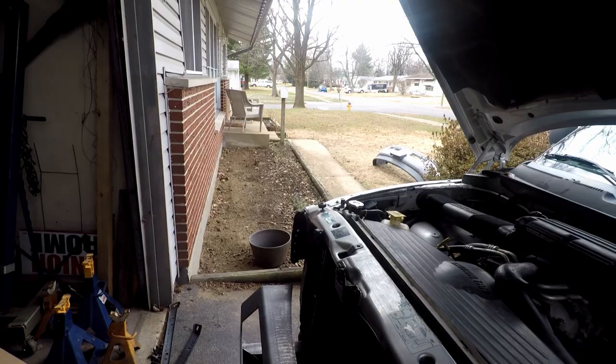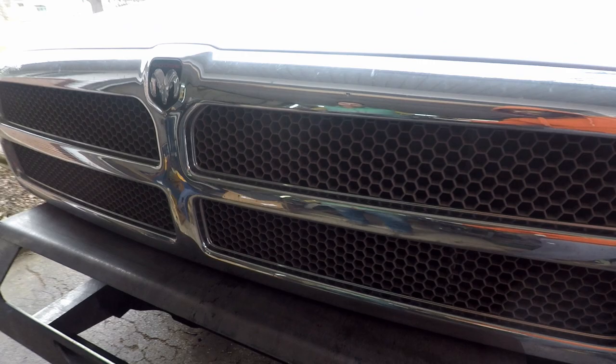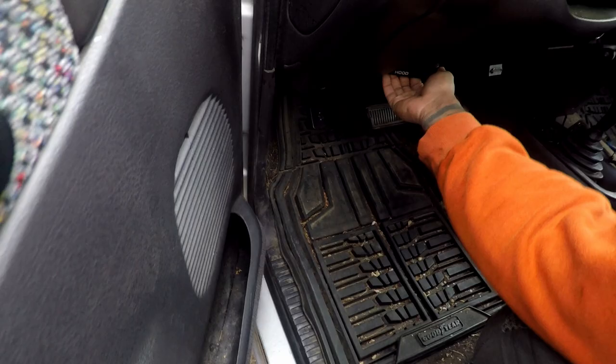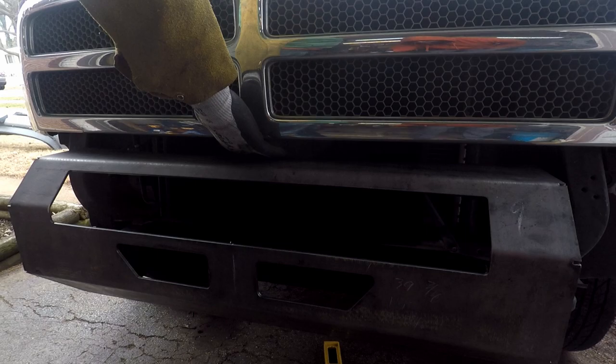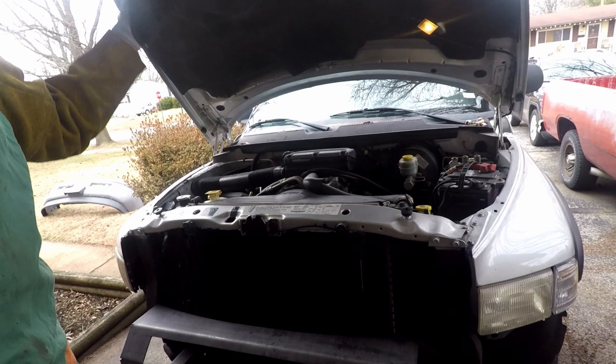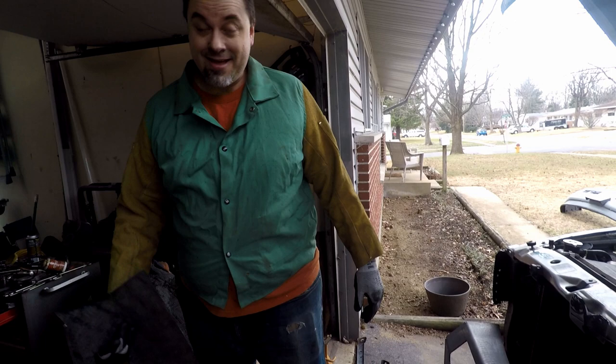Jeff tested to make sure that after popping the hood he could reach it. It's a pretty good fit there. The hood release — yours turns to the side instead of going out, but there's plenty of room to get the release. Just little things to think about along the way as you build your bumper at home. Jeff and I have been joking calling these the Ikea bumpers because they give you minimal direction — they give you some pictures and you've got to hope for the best. We're doing this video hoping it helps everyone else, because no one's helping us.